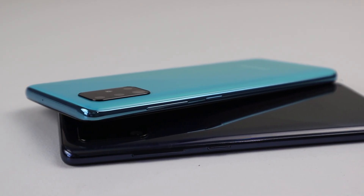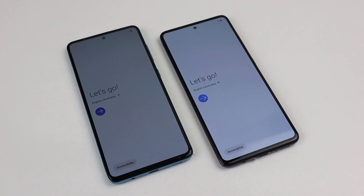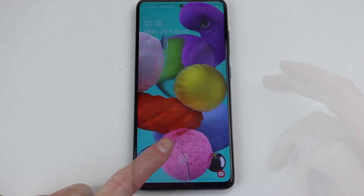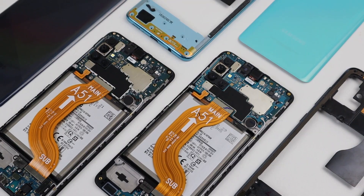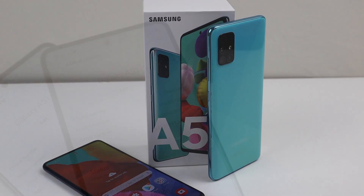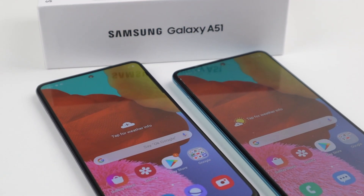So, this is it — the Galaxy A51. Both phones survived just fine with all features working correctly again. Based on my testing, Samsung has begun some form of component pairing thanks to a software update on this phone. Both the display and fingerprint sensor are paired to the phone, and changing either will break the fingerprint functionality in some way. Given the complexity of the in-screen sensor and my own experiences with it unlocking using the wrong finger, I can understand the need for calibration. The issue is not having access to the tool or software to recalibrate it. I also believe consumers should be clearly informed if some kind of repair restriction is implied on a device. If you like what you saw, hit that subscribe button and check out the repair, assessment, and teardown playlist for more videos like this one.